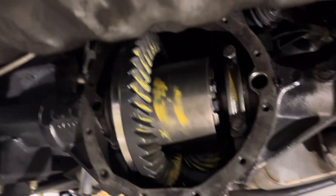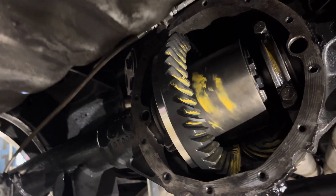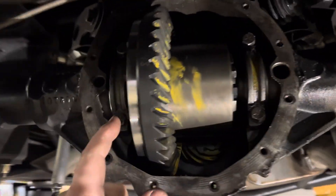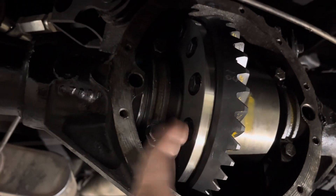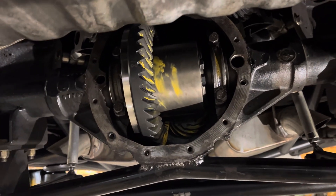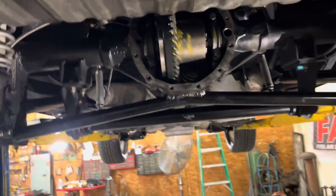This is the new one, which is the new TrueTrack. You guys can see my marks on there doing the grease line up and all that. But anyway, it's got six bolts on this side and the inside, and six bolts on this side and the inside — not just three bolts. So now that's obviously newer, better. It's a TrueTrack, top-of-the-line. This is a 12-bolt, so the car is strong.